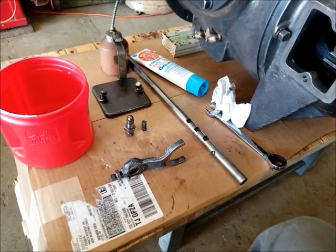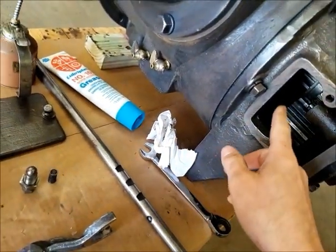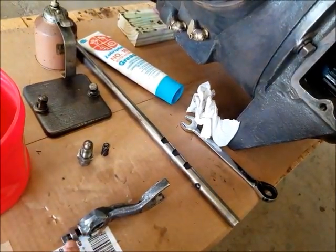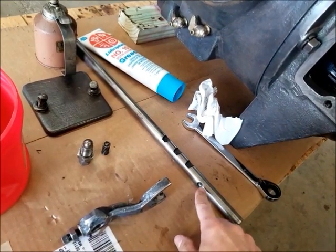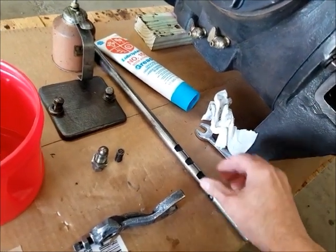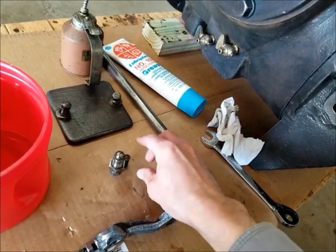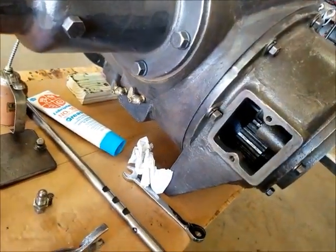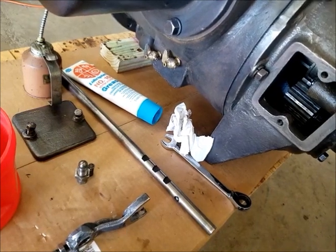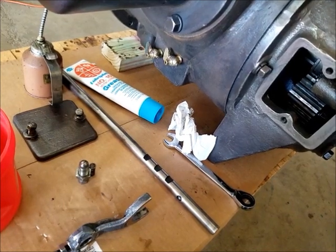After lunch, let's put the shift rail assembly back together. I'm going to take the shaft, slide it in from the rear to about here, get the fork positioned, bring it the rest of the way forward, tighten up the jack screw and lock nut into that dimple, making sure these are positioned up. Then I'll put all the spring, check ball, and nut assembly in through the top. I'll lube it all up with a little bit of oil so everything is coated, won't rust, and should slide smoothly.